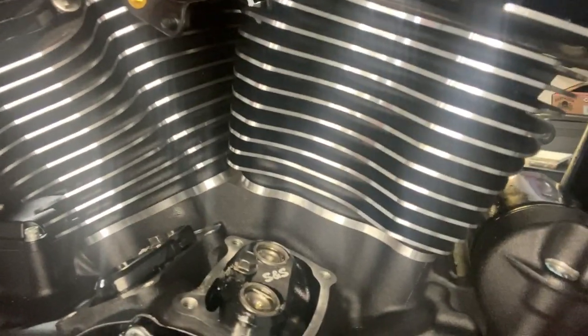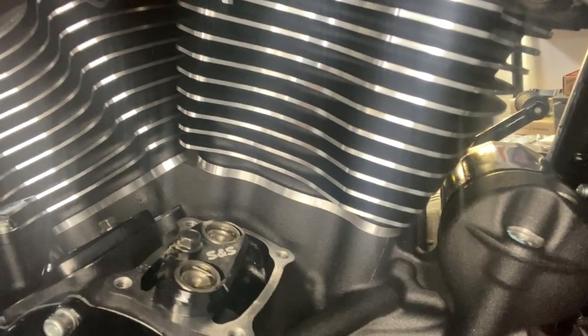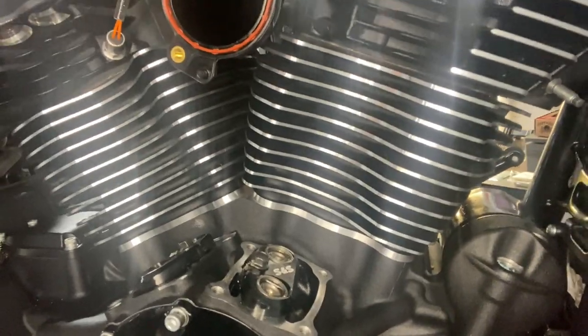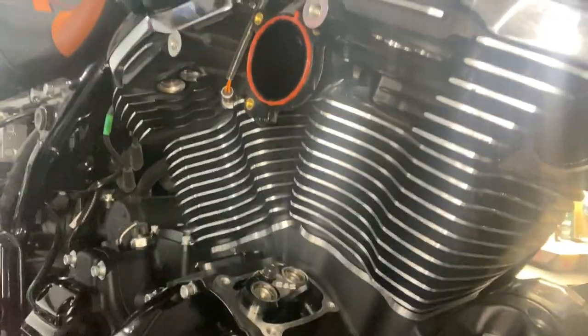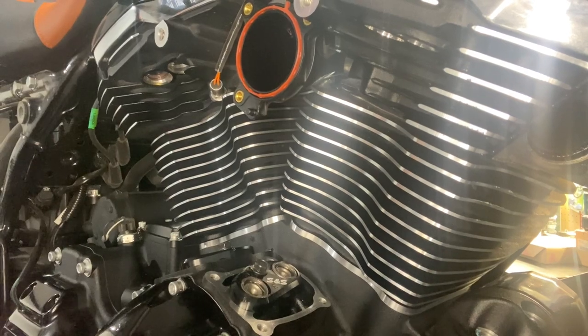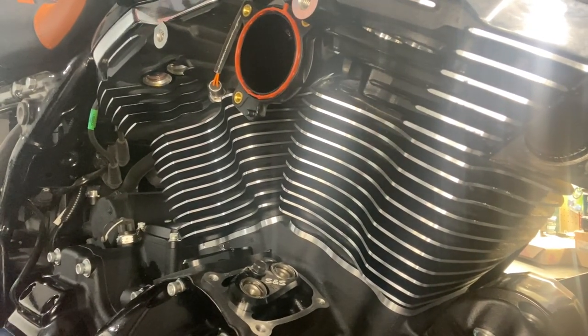We got them both moving. You can see that. So they're on the overlap cycle. So them being on the overlap cycle, that means we're good to go ahead and place our rear push rods first. So let's go ahead and get set up.